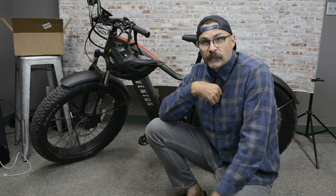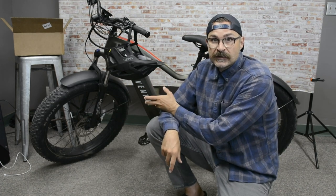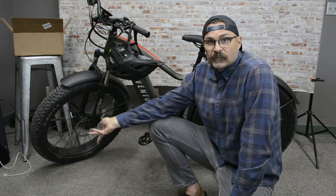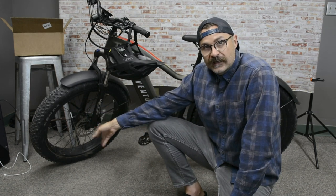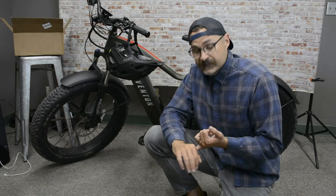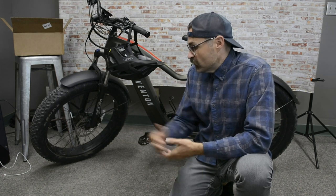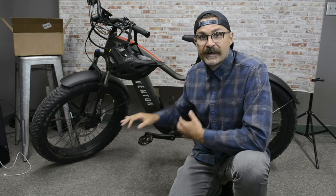So if you're new to bikes, or haven't been into bikes in a long time — a lot of people who are getting back into biking, especially my age in middle age or even older — we might not have been on bikes for so many years that we've never had a bike with disc brakes. There is a process of needing to bed your disc brakes in, in order to keep them from being super noisy and to make sure they give you the best braking performance. I didn't realize that, and I went out and started doing all kinds of tests, really hammering down on them. I explained that to the person in customer service, and they were still super supportive of sending me out the new discs and pads. So I was really impressed, especially since part of the problem might have been that I just never bedded them in appropriately.